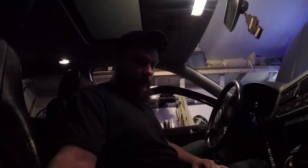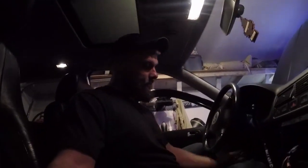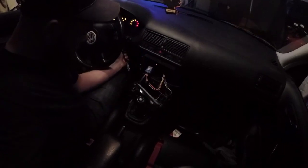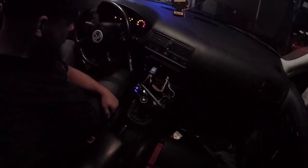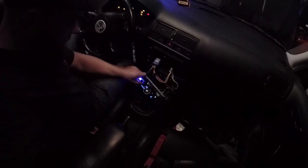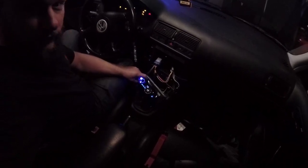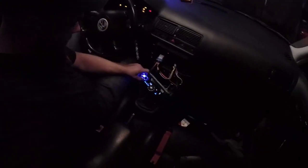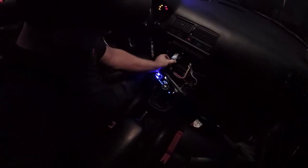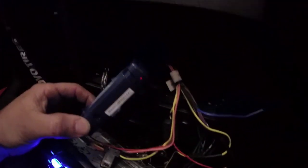And then I realized, man, what happened? Fuse burnout maybe? So I checked the battery. Yeah, sure enough, it was too low. So we're gonna go ahead and kick it on here from the accessory. And car's powering up. Here we go, folks. We got a radio. Not static because I didn't hook up the antenna connector yet, but it seems like we got everything. The fader works actually, and then here's that little LED that comes on, a little red light.